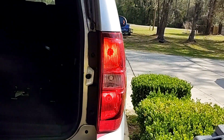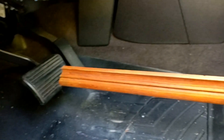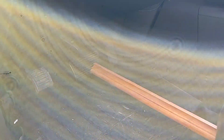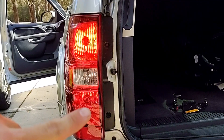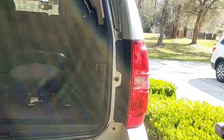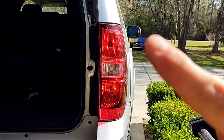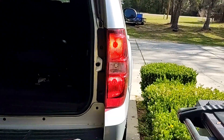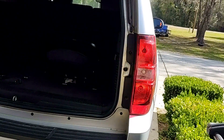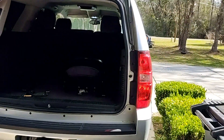At this moment, as you can see in the mirror, they are in sync with each other. Now let's apply the brake — brake pedal applied. On the factory setup, the top is lit up brighter and the bottom is still just the turn signal. But with my module, both function as turn signal even while the brake is applied. You'll notice they actually alternate with the mirror signal — that's just a side effect of the way the trailer controller box alternates between brake and turn signal.